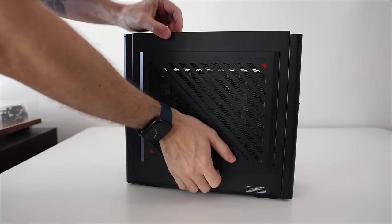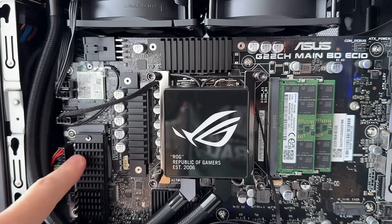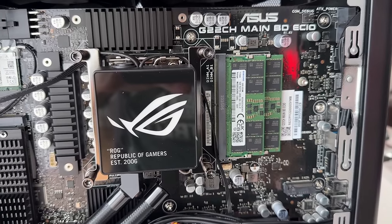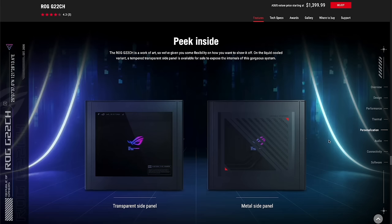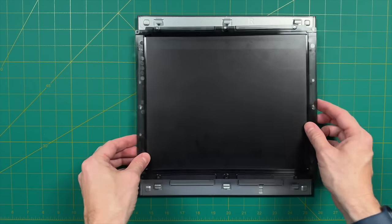On the right side, the CPU cooler with its liquid cooling is right there front and center. There are a few upgrades you could do: in the top left is the M.2 Wi-Fi chip, and right below that is primary storage with a heat sink. On the right side are two sticks of RAM, and further right there's another M.2 slot — if you want to expand storage with a 2280 drive, you can do that right here. That's about it for upgrade options. You could probably change out the CPU too, but I'd be nervous because of the liquid cooling.